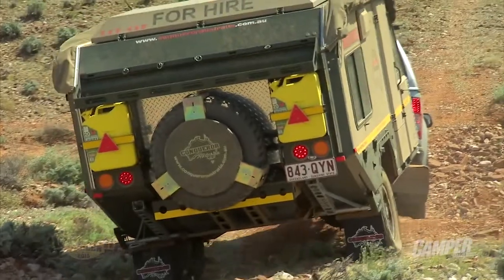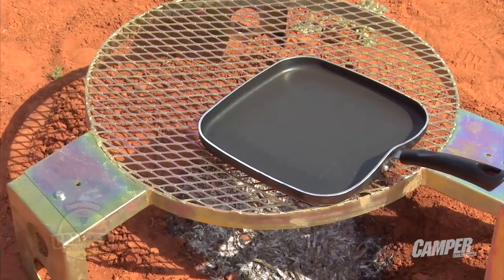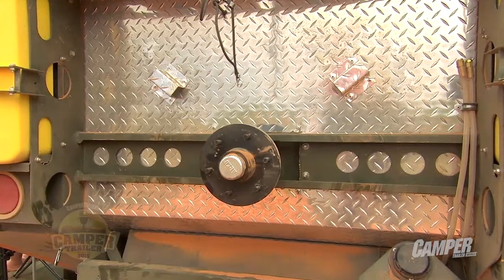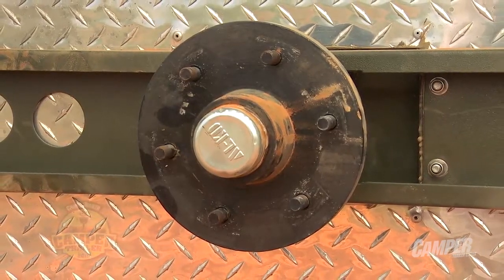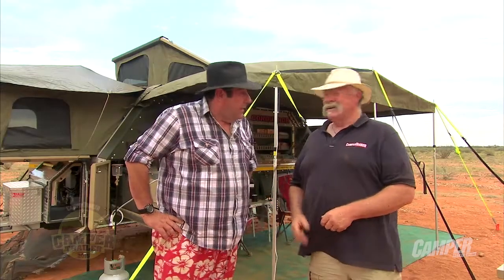While we're talking about wheels, the spare wheel's mounted on the back — it's got that beautiful bracket which actually has the barbecue. But there's a little secret there: in behind that, the mounting bracket is actually a complete spare hub. So if you do your studs, if you do your bearings, if you do anything on the side of the road, it's just pull the old one off, put a brand-new hub straight on — bearings, the whole kit's there ready to go. And it's a great idea. We've been doing it on boat trailers for years. It's about time to see someone doing it in this field as well.